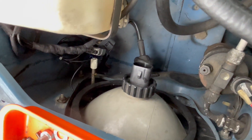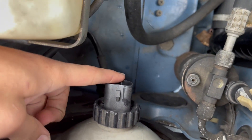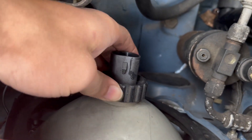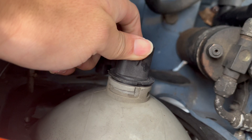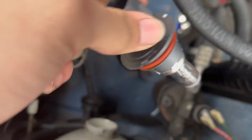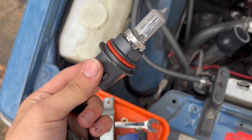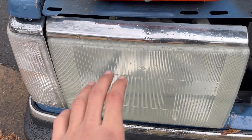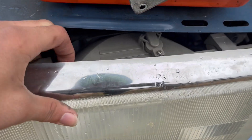If you're just watching this video to replace your headlight bulbs, you do not need to remove the grill and you do not need to remove those three bolts. All you have to do is lefty-loosey loosen this little collar right here, and once that's loose you can pull it straight off and your bulb will come straight out just like so. No need to worry about the grill or removing the headlight assembly.